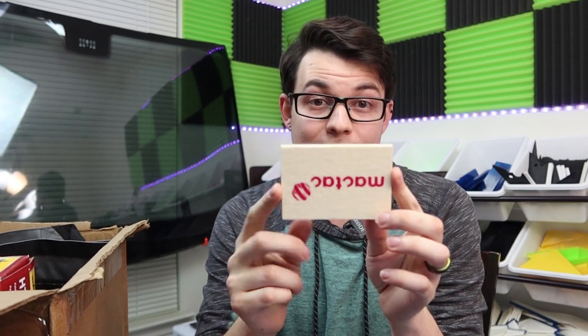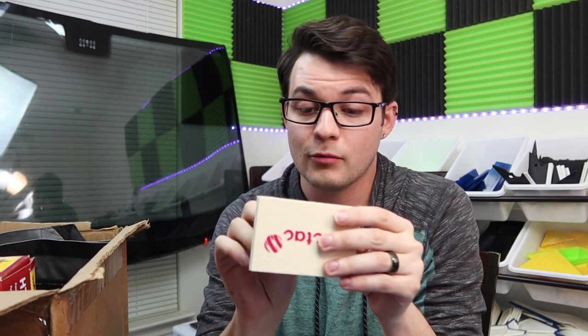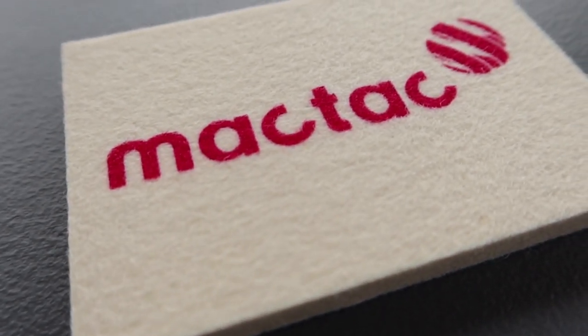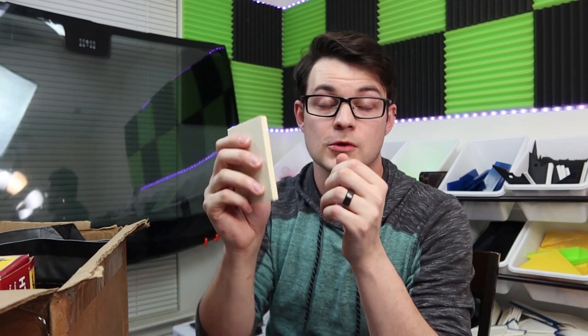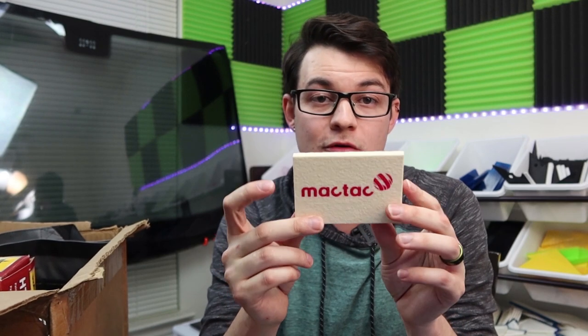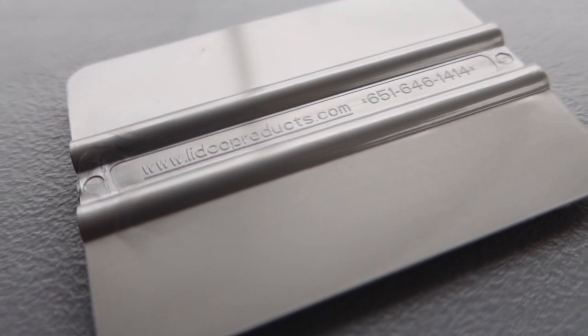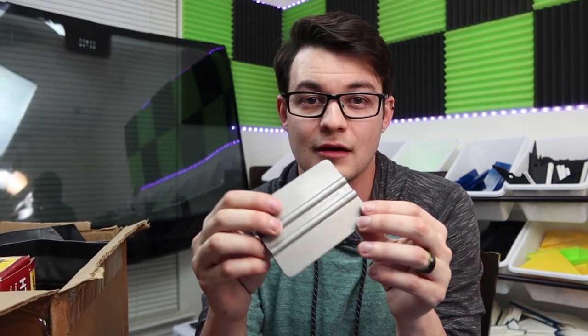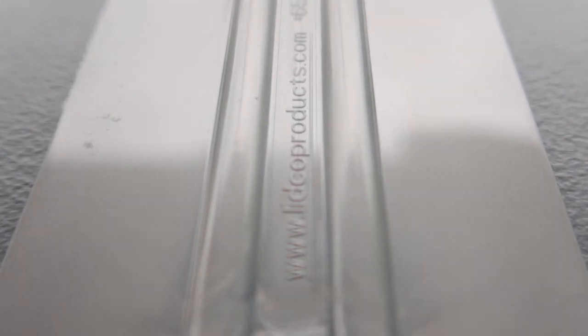These are things I've been recommending for a very long time. This is the Mac Tac - they also have a generic one on their website. This is a felt hard card, or soft card. The reason I like these over a regular hard card: when you lay out the film on a window and shrink it, if you have a little piece of sand, a hard card would rip right through it. I used to use a gold Teflon card but have since switched. These are popular in the vinyl industry, so highly recommend the Mac Tac or generic ones. We also have the gray Lidco card - a long-time tool - they have a nice softness and are great for heating up the glass and pressing out air from a dirt speck.